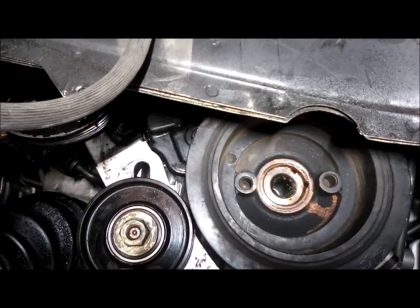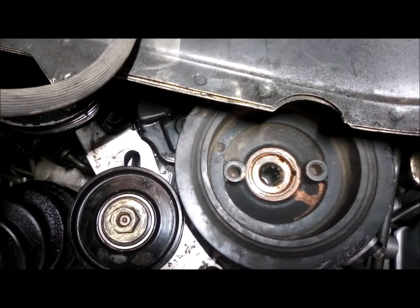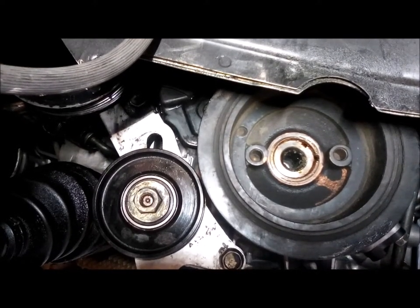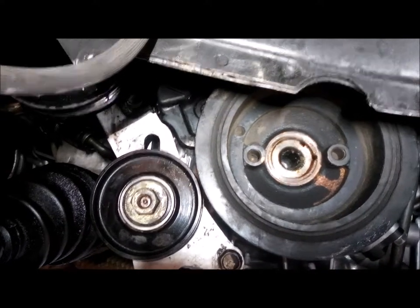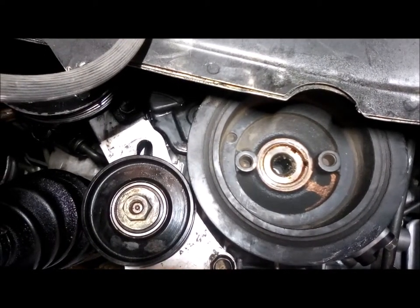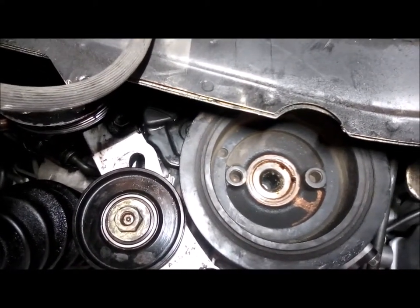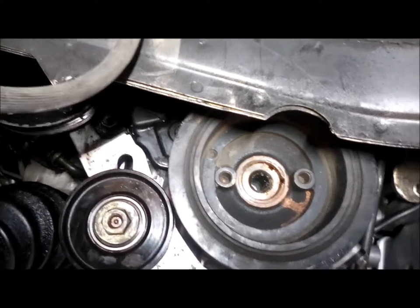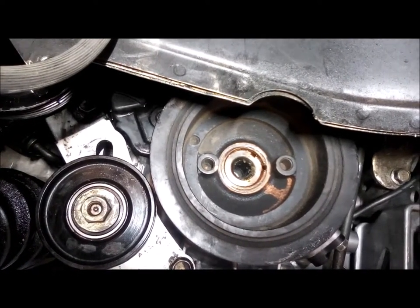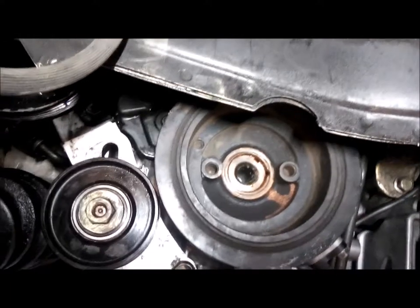Okay, so yesterday I fired up the 626. I had two problems. The minor problem is the power steering pump, again, leaking a lot of fluid. I think I got air in the system and it blew out the copper washers. That shouldn't be too hard to fix, but the engine's running horrible. It was acting like the timing was off, so I was thinking, uh-oh, maybe I didn't get the cam timing right. We checked it, and it looked pretty good, put the compression gauge on. Everything was looking pretty close.